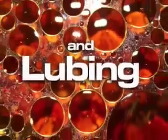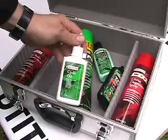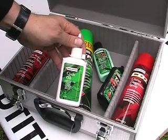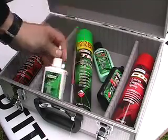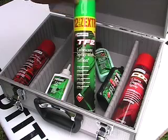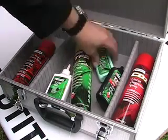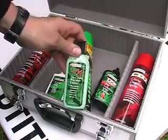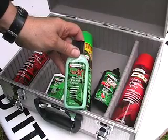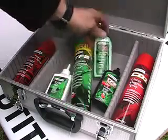There are lots of different lube types to choose from. This is a traditional mineral cycle oil, good for bikes with three-speed gears and perfect for squeaking doors too. This is a light, teflon-based spray lube that penetrates well, disperses water and evaporates to leave a dry finish. Some cyclists wax their chains — a laborious and messy job — but this wax lube does a similar job and it's a lot easier to apply; it repels dirt and is water resistant. This thick, so-called wet lube is long-lasting and good for winter use or long-distance cycling.